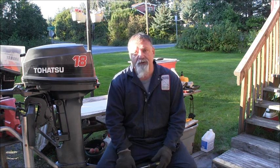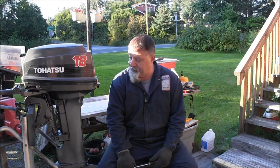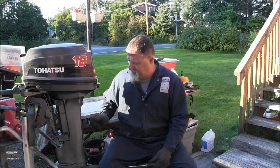It seems to pump water very well, and it runs cool. I did, after running it for 5 minutes or so, put my heat gun on it, and it's running fine, cool, but you would not put this little outboard to work without getting a new impeller in there, because it amazes me it actually pumps water, but it does. And I've looked under here. I do not see a telltale hole anywhere. It has the two blubber holes that shoot water out, and that's the way it's designed.